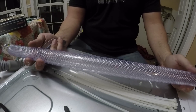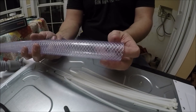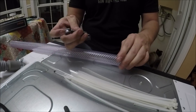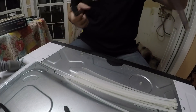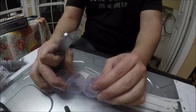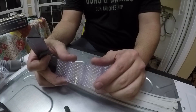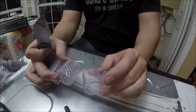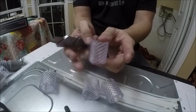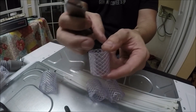First thing we'll do is cut this into four sections because there are four springs. I'm going to cut them into about one-and-a-half to two-inch sections — I'll make them all even, though it doesn't really matter that they're super long since the springs aren't super long. Once you have four equal-sized pieces of rubber hose, if it's one-inch inside diameter it's going to be slightly too small, so I'm going to split them down the middle so I can wrap them around the spring.